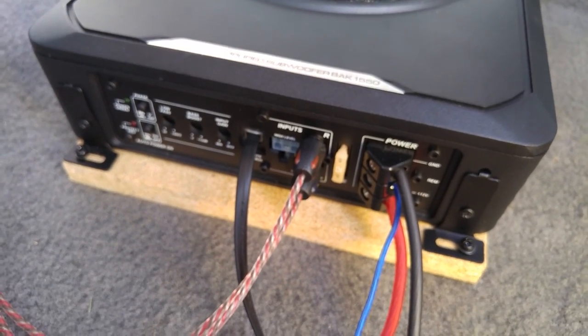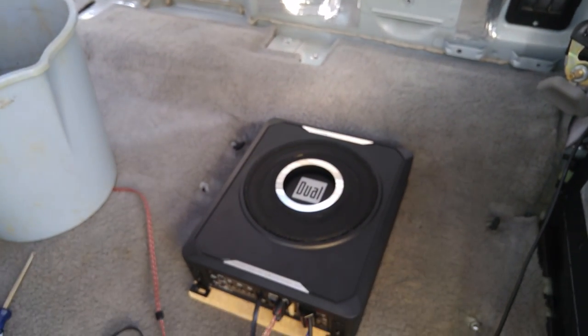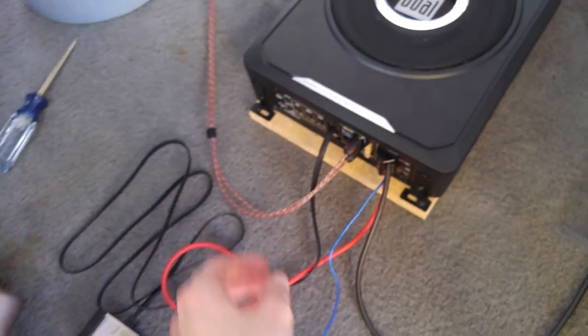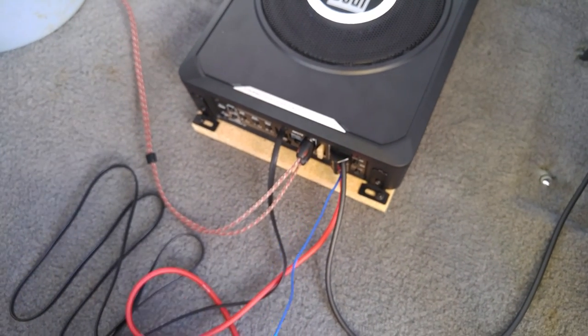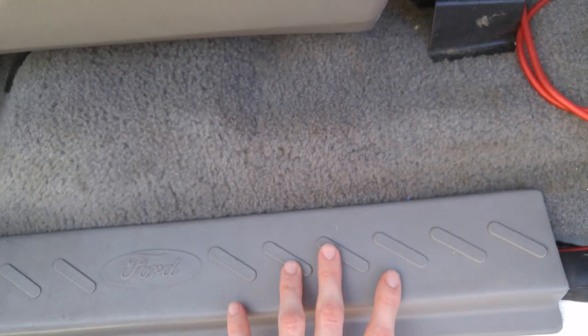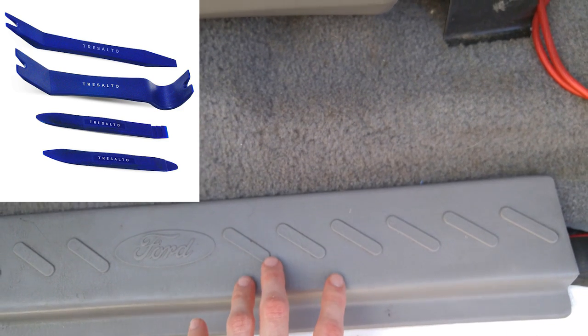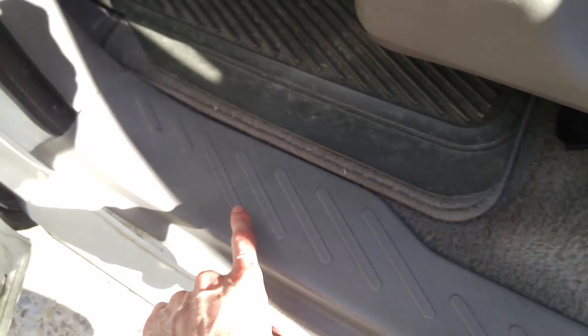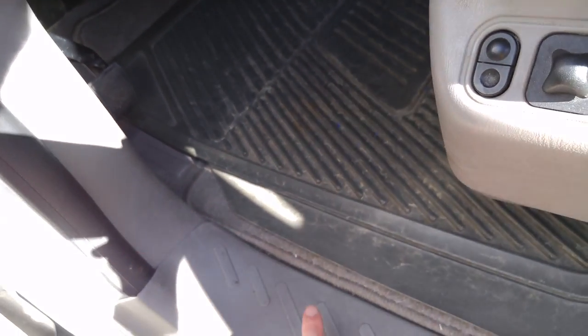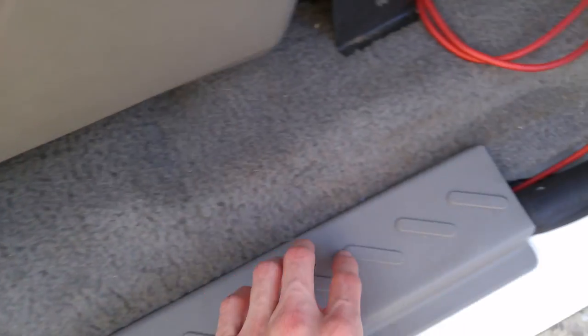I've adjusted the settings for the best sound in this truck, but it will depend on your vehicle. I'll be putting the seats back in and will probably orient the sub sideways so it fits better under the seat. Now I'll go ahead and route the RCA cable and the blue turn-on cable to the other side of the vehicle. Just remove the door trim — it pops up easily. Trim removal tools are great here so you don't break the clips. I'll show you the path the power cable takes from the battery through the firewall, and I'll do the same on the other side for the RCA and turn-on cable.